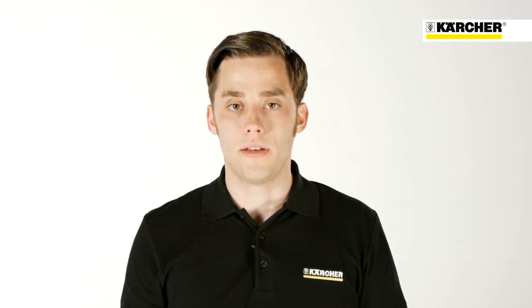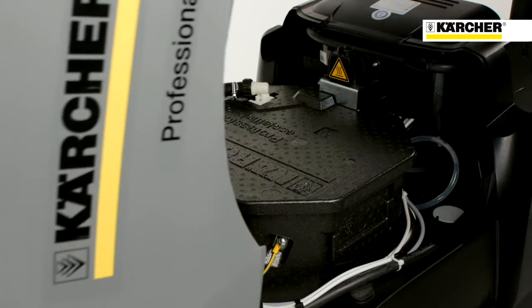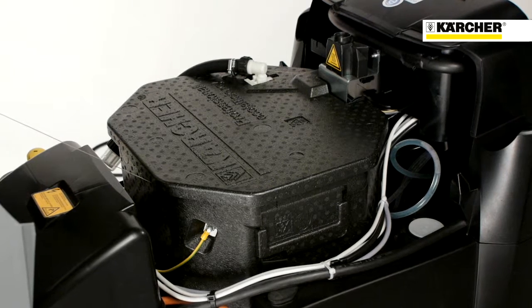Above you can find several indication lights that show the status of the main machine functions. If we take off the cover, we can have a look at the inside of the machine. The outstanding feature is the highly efficient boiler with its patented insulation that reduces energy consumption in standby mode up to 40%. The boiler has a large capacity of 58 liters and provides maximum water temperatures of 85 degrees. A fast warm-up time can be achieved because of powerful electrical heating elements and an additional preheat chamber in the 12 kilowatts version of the machine.